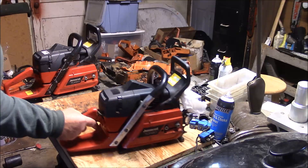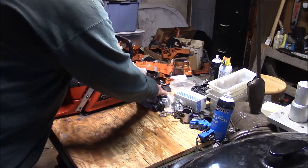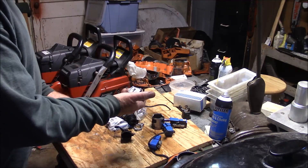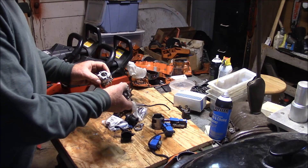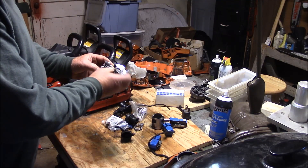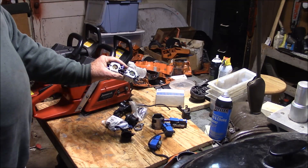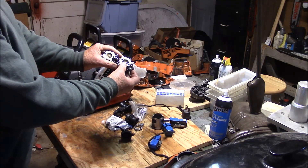Now since I opened up that door, here are a few bits and pieces I had not mentioned before that you have to consider for completeness. Carburetors - this is what the X-Torx have, and there are a couple of different versions. This is what the original editions had. Basically the original editions had some version of the HD-12 Walbro - a little bit smaller bore, completely different. The biggest difference being how the screw holes are oriented relative to the carb - if you put it on the original brackets it would be rotated versus the stock one.